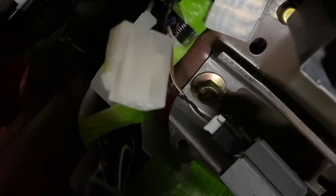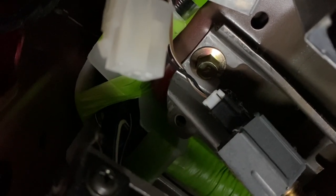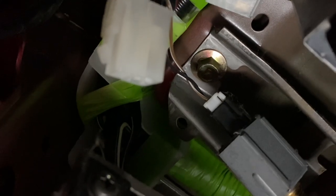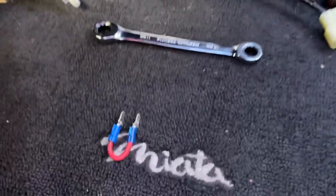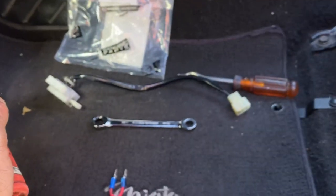The clutch switch is there so that if you start the car and it's in gear, the clutch is in and the car won't lurch forward. If you have it bypassed, you could start the car in gear and it would just jump. So that's why they started putting these in. Lots of people, however, have decided they don't want that because it's just cheaper, and of course if you have to replace a clutch switch, it's also a lot easier to just insert the jumper.